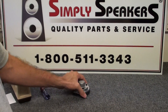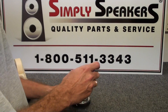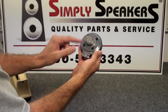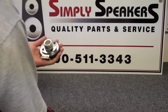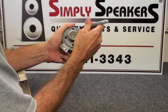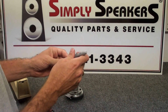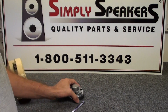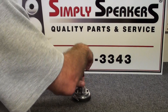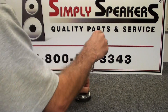The first thing you want to do, once the driver is removed from the cabinet, is use a quarter-inch nut driver to remove the four screws. You'll see there are three non-used holes that make it easy to line everything back up, but we like to take a marker and put a little line at the top and right on the magnet as well, just like that — so it's easier to remember how to line the pieces back together. Just set those screws aside, because you will reuse them later.